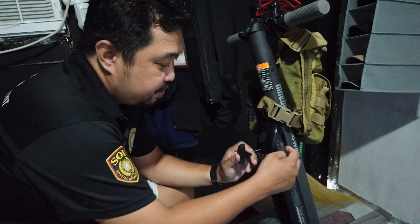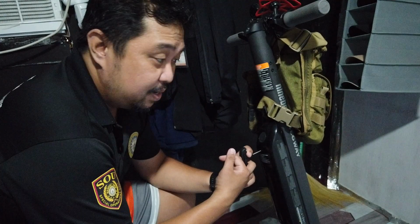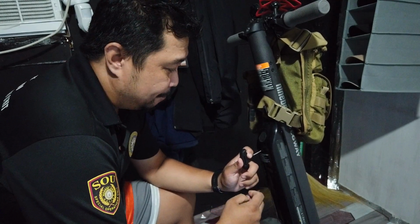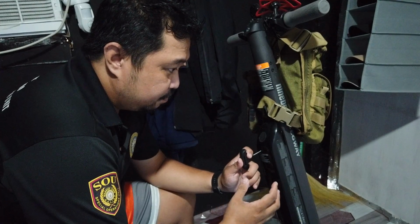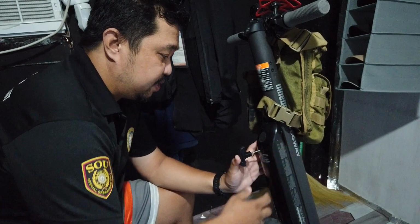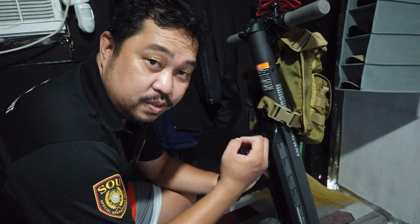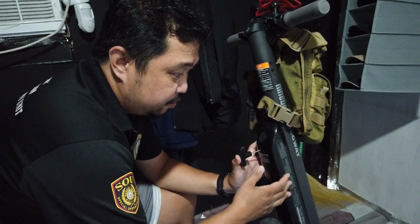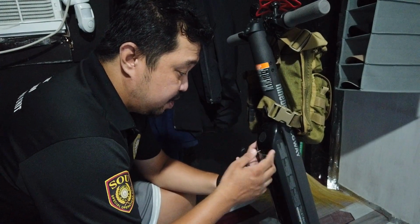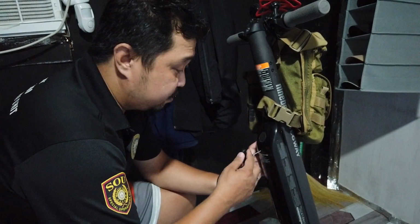By the way, this screw here, the Allen screw, is connected to a bracket, which is connected to the frame of the ES4 scooter. The purpose of this is to make it sturdy, but sometimes it causes a problem, and when the bracket vibrates, the screws loosen, and you have to tighten the screws of the bracket. Also, you have to tighten the Allen screws here on the battery, but it doesn't really solve a lot of problems.